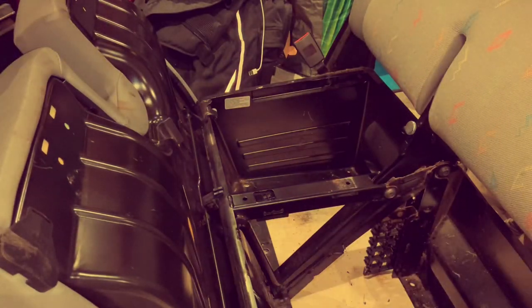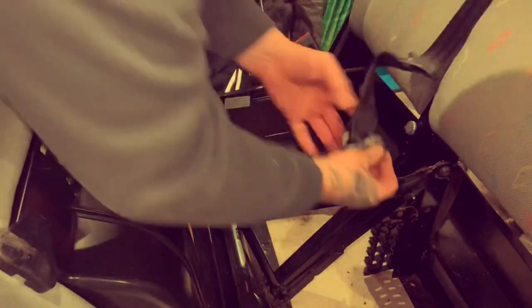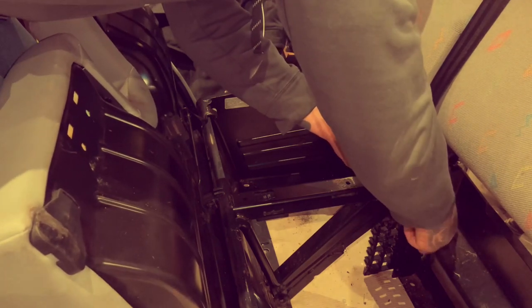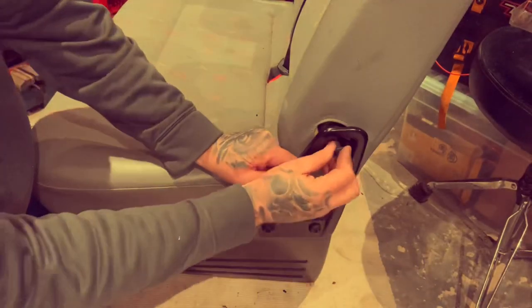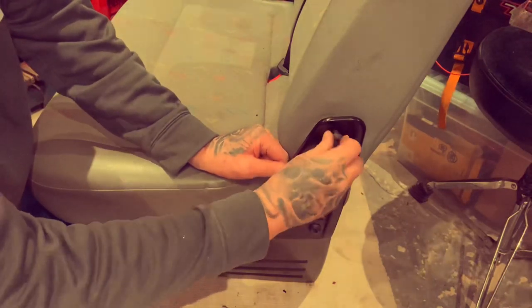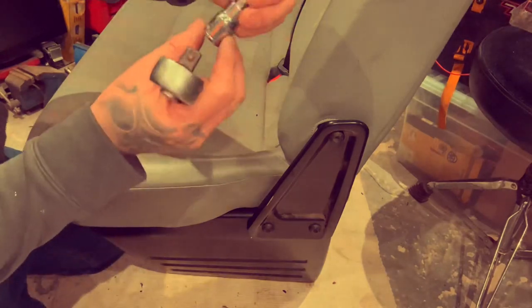Your two bolts in, now put your seatbelt bolt back on. Seatbelt back on, 17mm bolt, straight through. Remember, get your belt nice and ready. You don't want to lose anybody. Then you just let go of your side bracket, two bolts on either side. Just make sure that washer is there, so it pivots on that. So we're back on to the M10 spline socket.